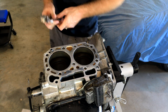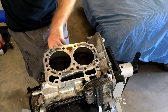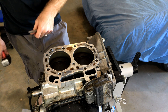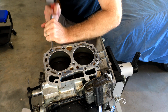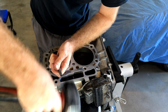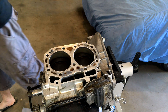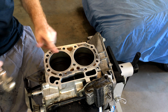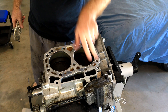So now we do the same with this one. Now this is an internal one, so as we crush it, we've got to try not to push it down inside the block. Give it a wriggle and out she comes. Got them both out now without damaging the deck.